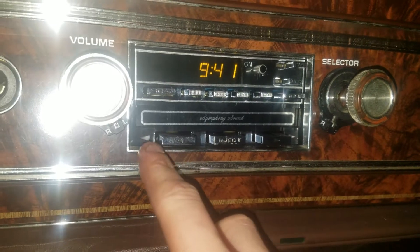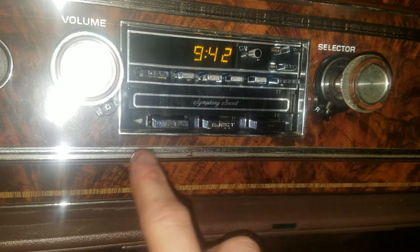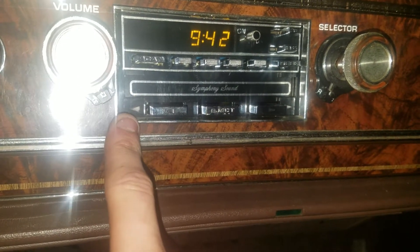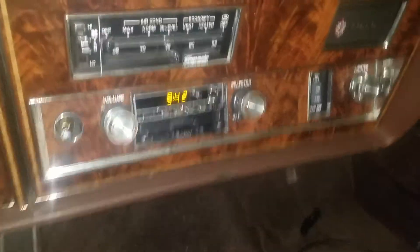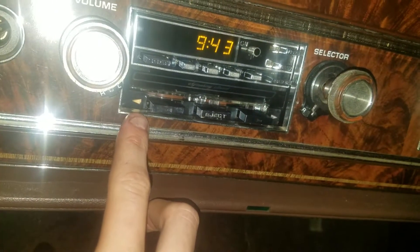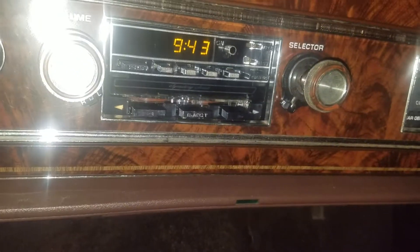The other issue I was looking at was the direction in which my tapes were playing. It was stuck playing in the forward direction and it wouldn't go back the other way, with no way to manually switch it. My tape adapter doesn't play on that direction — it'll play with very quiet audio and a very high-pitched electronic interference, whereas with this direction it'll play clearly and loudly. I actually figured out that if you take your tape and put it in this way, now it's playing the tape in the correct direction. All that does is when the tape is done, it will auto-reverse within the deck and switch sides, just as a regular auto-reverse deck would work.